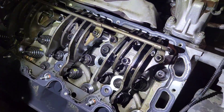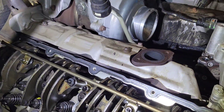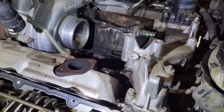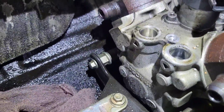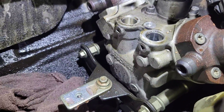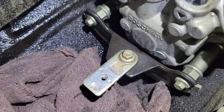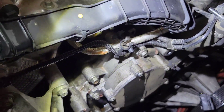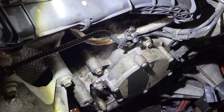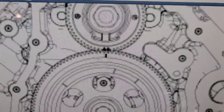From here I'm going to get this cleaned up, get a valve cover gasket, and finish doing the fuel system. There's the back side of the pump — we've got it just about ready to come out. We need to take off this bracket with two 8mm bolts for the fuel lines, and get the vacuum pump off. That's all we have left on the fuel system in the engine compartment.